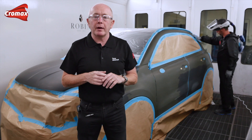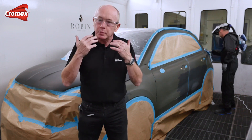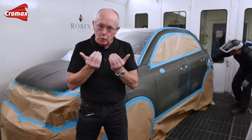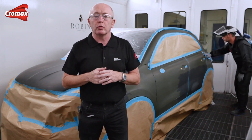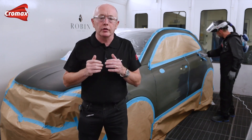The car is prepared. The prep work for matte colours does not require any specific process changes, but it must always be of good quality as any imperfection in the preparation stages will be more visible — matte colours absorb light and reveal mistakes more readily than a gloss finish. Don't forget to use the correct undercoat colour as stated in the colour software for your formula.